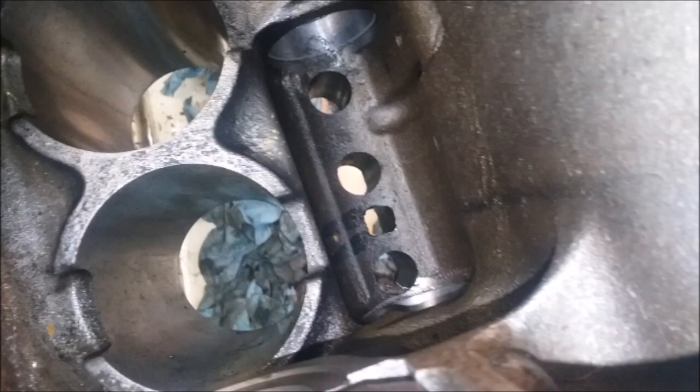Something I didn't cover well: using a brass brush and Purple Power to clean any machined surface. Any machined surface — including where it was line-bored, the cylinder bores, the tappet bores — I cleaned with Purple Power and a brass brush until I got no film, no residue, and no discoloration on a paper towel.